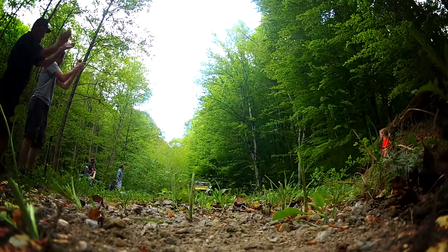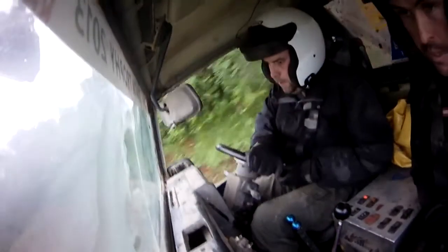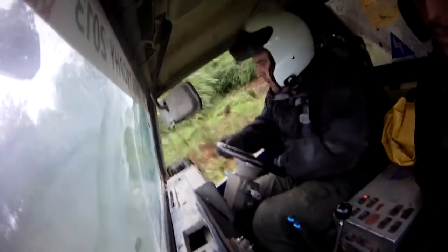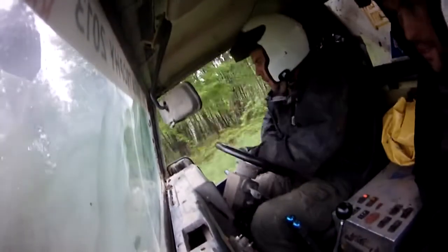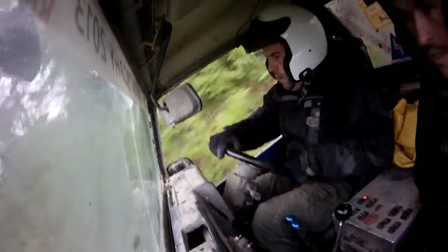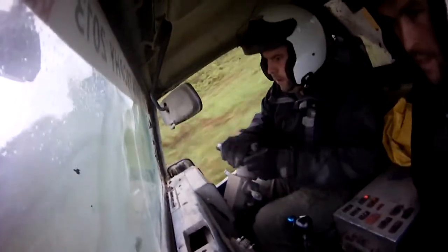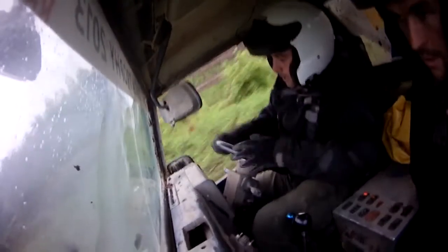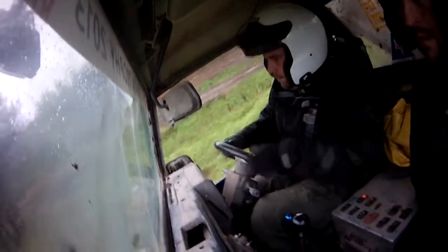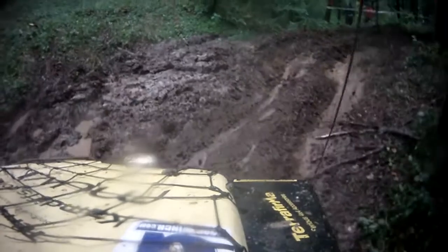Just before Croatia Trophy last year, I was in two minds whether to fit the steering dampener or not, as prior to this I'd been running without, after a cheap stock one had failed. But what made me fit it was the type of event: 8 long days of only off-road driving. The tight, muddy forest tracks require a lot of steering input, as can be seen from our in-cab footage. So I was hoping by adding the RTC damper it would help lighten the steering and reduce fatigue. It definitely did help, and the steering felt really much more responsive.